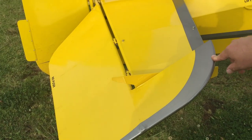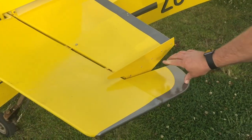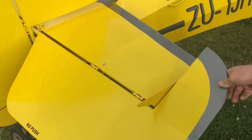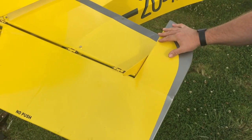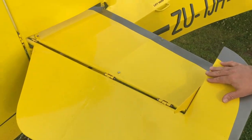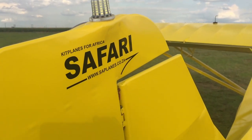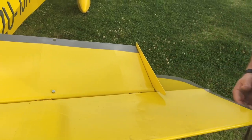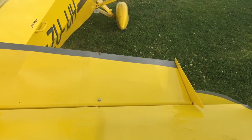With the certification of the Safari, we quickly realized that without the balancing horns in the back the aircraft would not be certifiable, so we added some aerodynamic horns to get our stick forces right and also to take away the pitching moment that the wing produces when you pull the flaps. We also added a stall fence in between the surfaces, which directs the airflow a little bit better so you have more elevator control on landing.